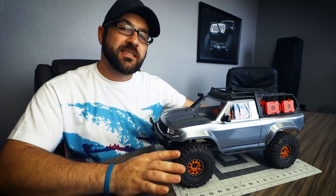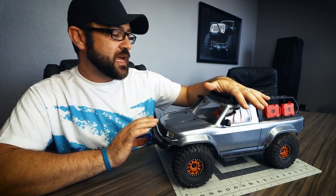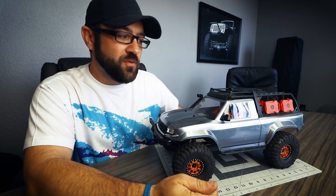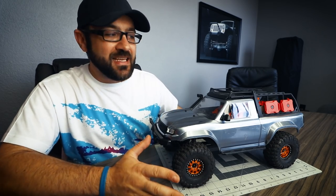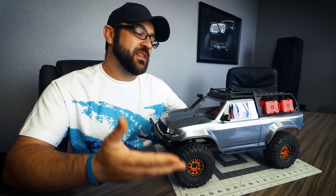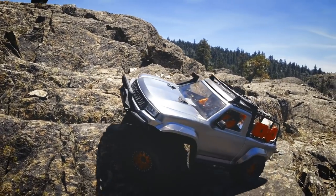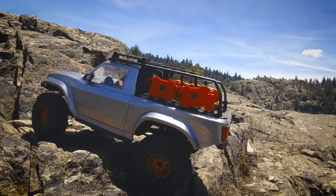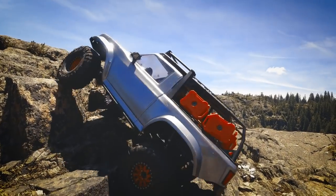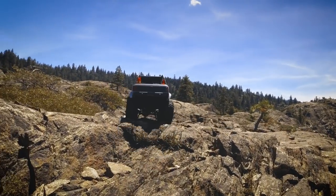For this week I want to touch first on last week's running video. We took this truck out on the rocks for the first time — done a handful of upgrades and tuning, beginning to get it rolling in the right direction. The biggest thing is that TRX4s are very top heavy. The portals exaggerate that by moving things up, and other design factors make the truck more top heavy and less capable on steep climbs and side hilling. I get why people load the axles up with brass, because that compensates for the top-heavy nature of other parts of the truck.